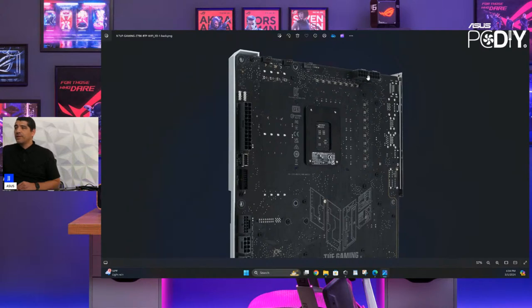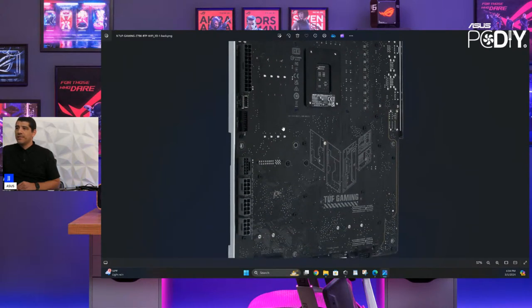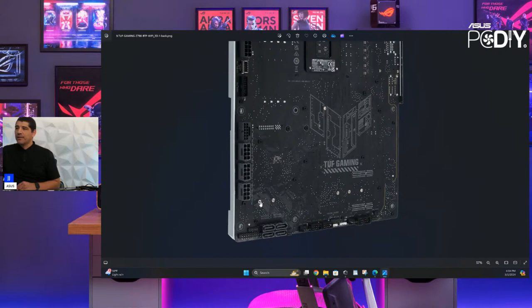So your EPS, your CPU fans, your 24 pin, your USB-C, your legacy USB 3, the 12 volt high power, and then your auxiliary PCIe 8-pin power connectors. You would just connect into that depending on which graphics card configuration and which corresponding hardware you're going to be utilizing. If you weren't aware, that is what he's talking about when he's asking about BTF. Okay, so that's going to be BTF there.